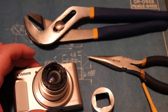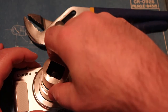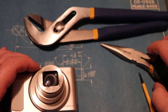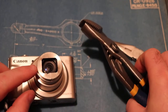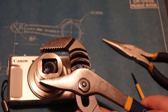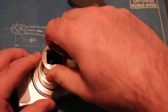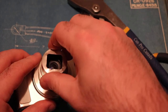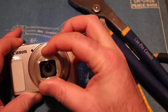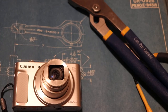You can put it back on. The way these fingers are, they're kind of opposite of a normal bolt — clockwise versus counterclockwise. If you have the camera jammed where it's partially open, you can use a pair of pliers, maybe put some tape on the jaws, and very gently grab this. Go counterclockwise and lift it out. You should try to get the opening horizontal — it might not matter in most cases, but it can get clocked out of position a little bit.